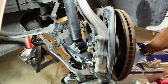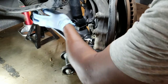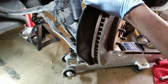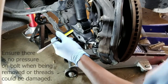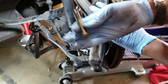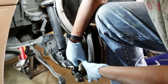I lowered the jack to relieve the pressure off the control arm, and now we should just knock this bolt right out — it comes right out. Work it out. We're going to put these together and take the steering knuckle off the ball joint — it just comes right off.